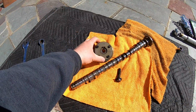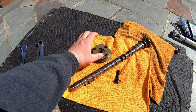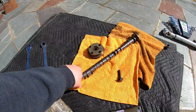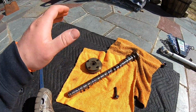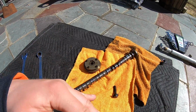Leave it. No. Now I'm ready to basically order my 50-degree VTC. I can get one for like 170 right now on sale, which is not bad, but you know, just tossing this thing. Obviously, the only problem that I'm gonna run the risk on, and essentially I didn't even want to run the 50-degree VTC when I found this out, is that you need to, damn, I just dented my cam. So when you put the 50-degree VTC on this thing, guys, you're definitely going to want to have a really good tune that is not going to allow it to advance the full 50 degrees.